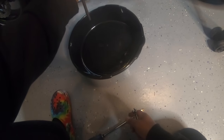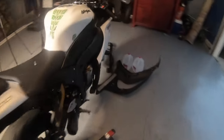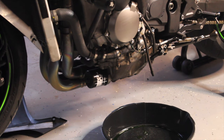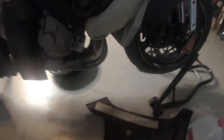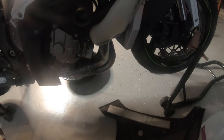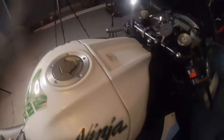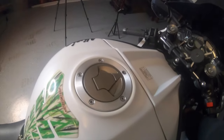If this bike has pressure built up it's going to splurge out. The next thing you want to do is go over to your cap — mine is right here — and you want to loosen it up, and it should start coming out. The coolant was super low but it's still draining. Once you get a good empty from this, get that screw and button it back. You may still have some dripping but go ahead and button the screw back — that's when your cleaning process will take place.